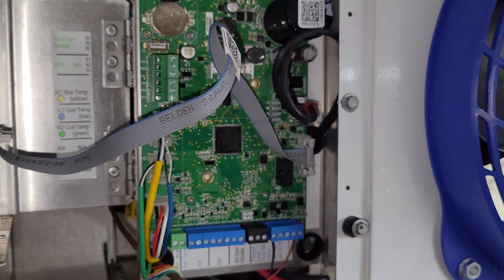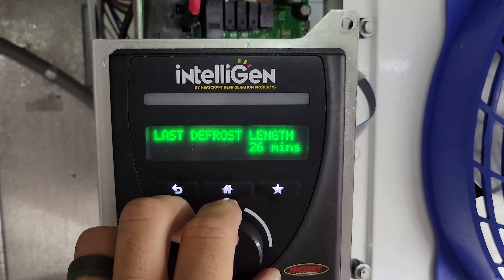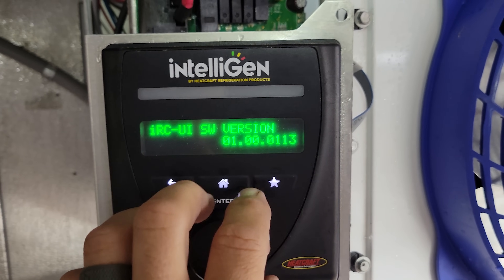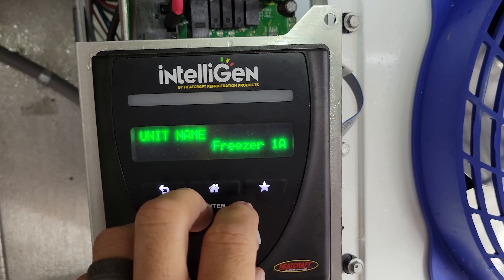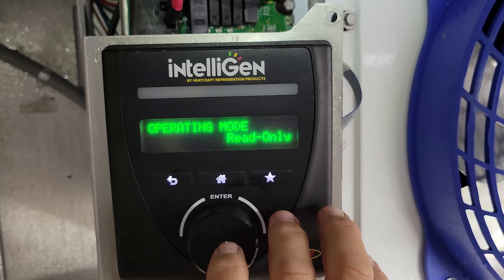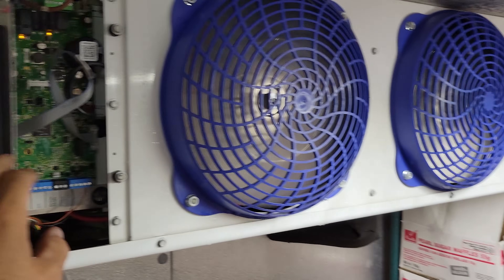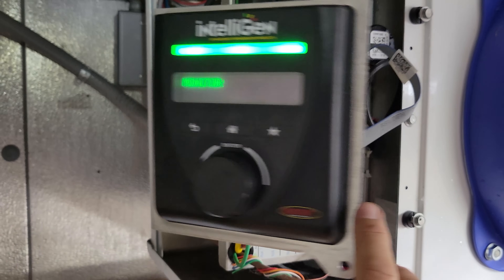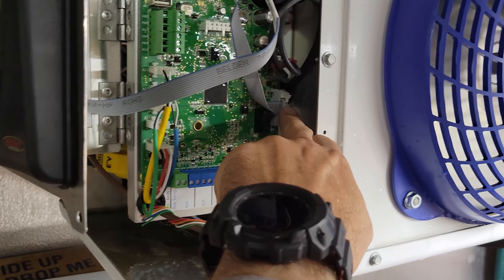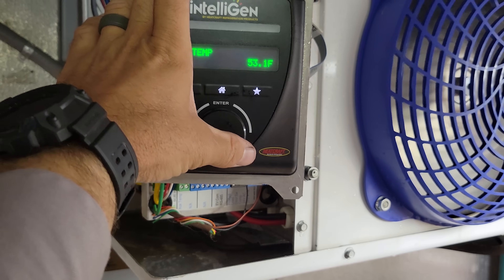I don't see anything in here that would have caused it to do anything funky. It says board voltage 25 volts — that's good. That's defrost. It has memory, so it's not like the board is completely blank. Operating mode is off — we've got to get it to turn on. I notice this light is falling down. I noticed that this cable was coming out — the cable was loose. I pushed on it and then it started running. There it goes — it just turned on.